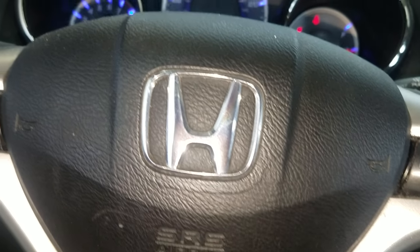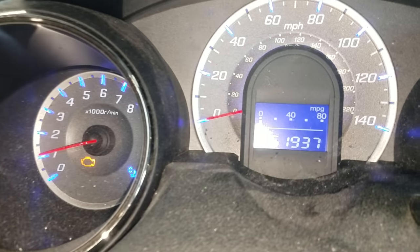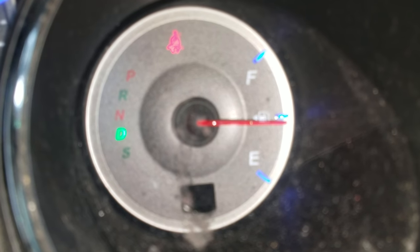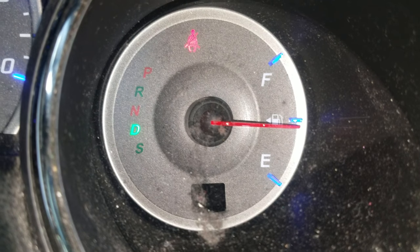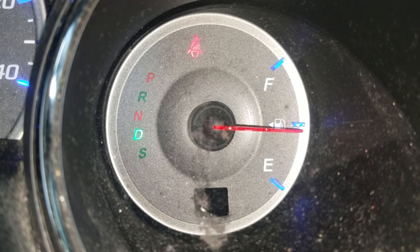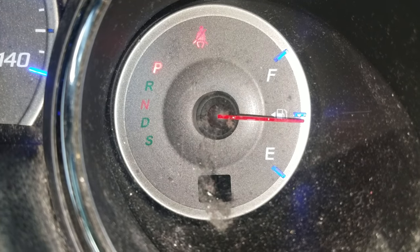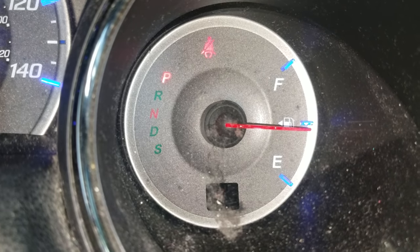FlatRay Mechanic here. Just wanted to do a quick video on what you should do if your drive light is flashing, or the D light is flashing. The D on this Honda, when I brought it in, it was flashing. I actually cleared it because I wanted to see if the code was going to come back, and it did. But if you have a drive light that is flashing on your Honda, basically what that means is you have a transmission issue.